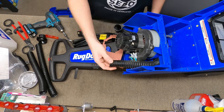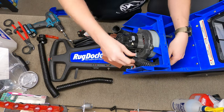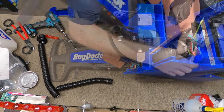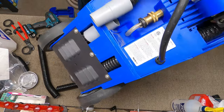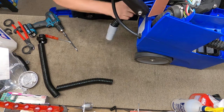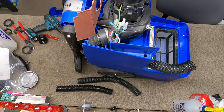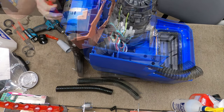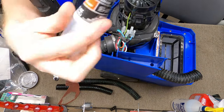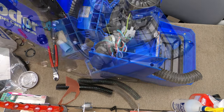Now we have two different hoses, and you'll see where the short one goes versus the long one. You can see there's a zip tie right there holding that sucker in — at least it's supposed to hold it in. Usually you weasel it out. The long hose, as you can see, there's silicone in there. That will go in here — give it a quick press and you can pull the zip tie out. I prefer GE Silicone II; I'll put a link below — that will benefit the channel if you want to help us out.